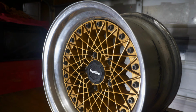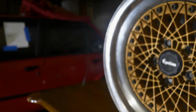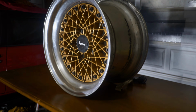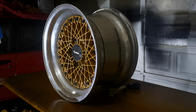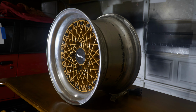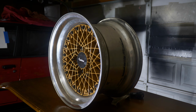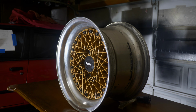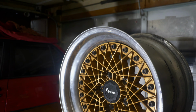But like I said, it's my first time doing any kind of three-piece wheels, and they are going on the E30 if you guys don't follow the build. So it should look pretty sick. These particular wheels, if you didn't follow me when I got these, are 16 by 9.5, 27 offset. So I am going to be running adapters because I have Style 5s to put on the E30. So I'm just going to run the same adapter for these. Hopefully I can get a good measurement of what they should be, because I really don't want to buy spacers twice. I'd rather just keep the one set of adapters on, and then just swap the wheels out whenever I need to.